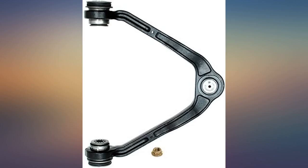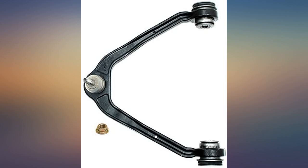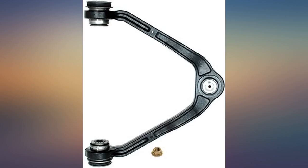When you torque these to specs it crushes the holding pockets down onto the bushings, as it should. If you have a rookie alignment technician with zero skills, they will try and sell you a caster-camber kit for some exorbitant amount of money, which is totally unnecessary — that's after they try to move them and bust out your alignment pins.